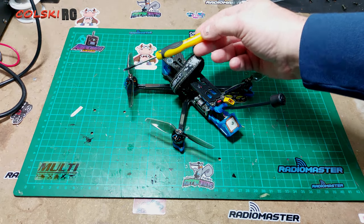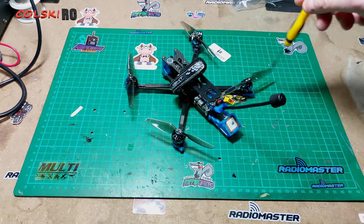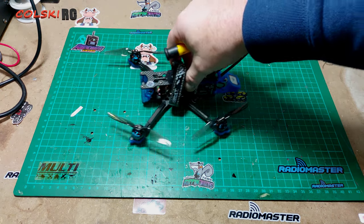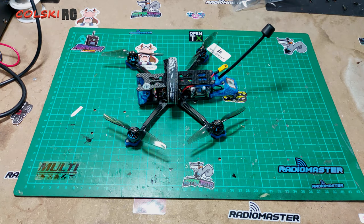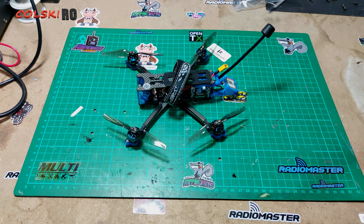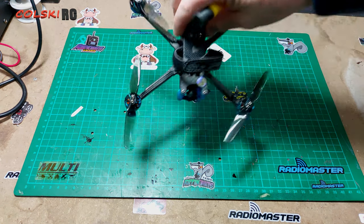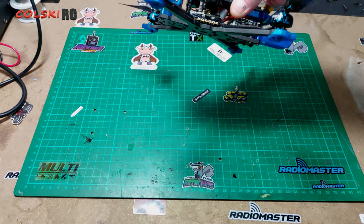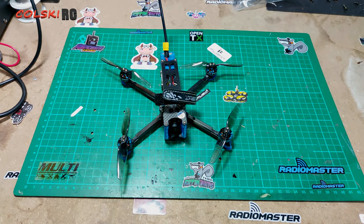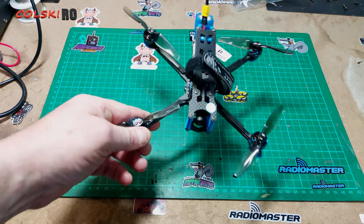this motor, you'll see in the video, spins, the other three don't. Well, they do, but they catch and they hack. Put it onto Betaflight, you get exactly the same result if you run your motors through. So it looks like it's possibly the ESC. However, when I swapped this motor there, it ran, so it makes me think it's a motor. So I've contacted Banggood and iFlight, and I'm being sent out four motors and a new ESC. That should solve the problem. So I'm not really going to whinge about that. Quality control, sometimes these things can happen.